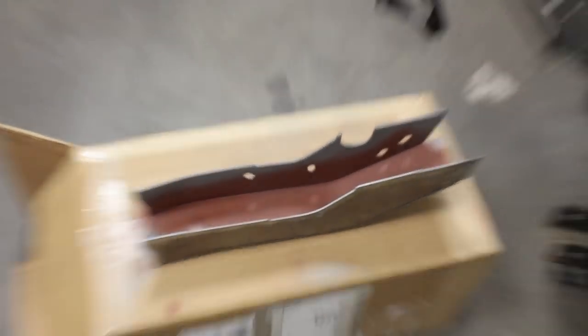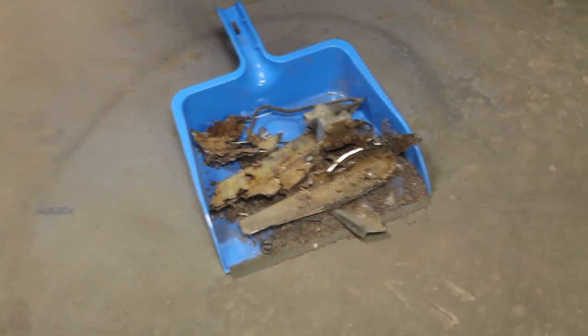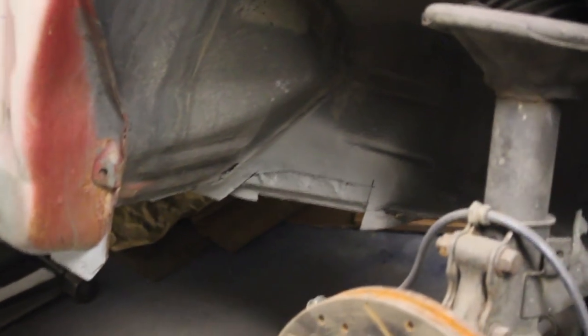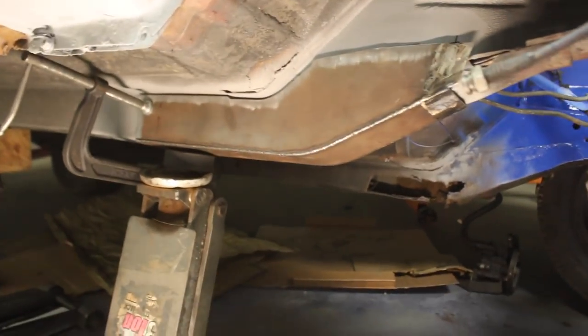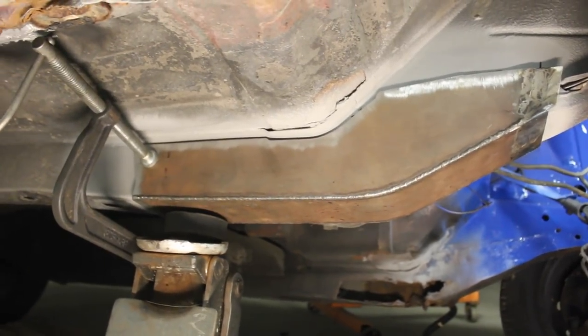As we let that dry up, we also cleaned up our work zone - looks ten times nicer, feels a whole lot better. This is what we chopped out and ripped out of there. We got it all primed up and ready to go. Don't mind the kind of nasty cuts - this is my first time doing a frame rail replacement so I'm learning as I go. Quick update: we have the jack lifting it up and pressing it against the car, the gap is super tight, and up there I put a big old C-clamp and clamped the upper ends of the metal together because they're a little bit too wide. It looks fire, so let's go ahead and weld it up.